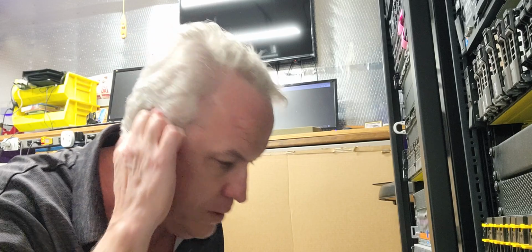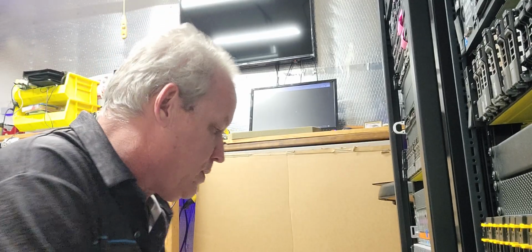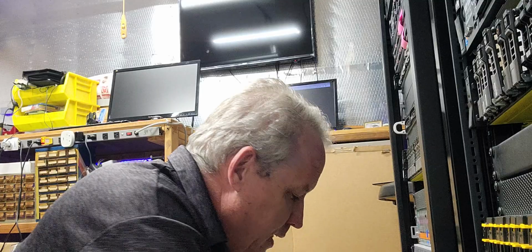And then down here, below out of your view, is the 2246 NetApp DS disk array. I'm going to adjust the view so that you can see this in time. But for now, we're just getting you into the process a little bit here. Over here, I have a stack of my hard drives. There are 10 of them, and I have roughly 7 additional drives in here as well. At this point, I'm going to remove those disks. I'm going to try to keep maximum capacity disks in there. Anything 465 or lower, I'm going to remove. So that should give me some pretty good clearance.